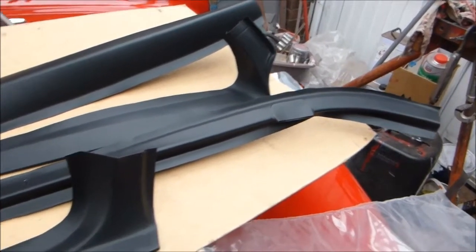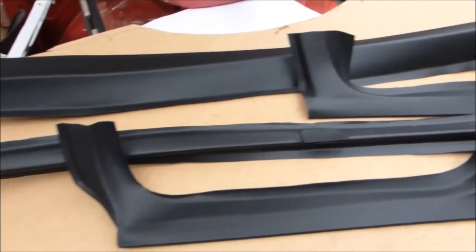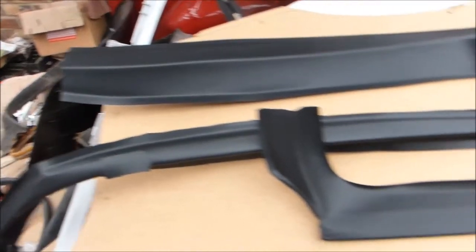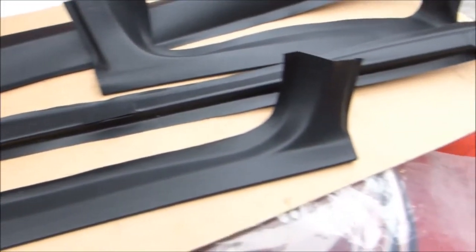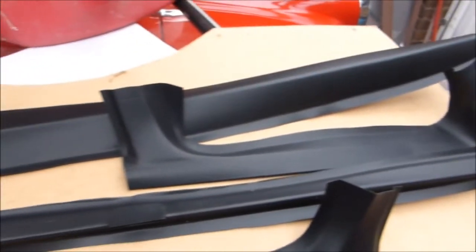If you've had trouble fitting the vinyl to the windscreen of a TR4, as I did, this is the alternative. This is a moulded set, which is a little bit more expensive, but you'll see that the fitting is that much easier. I've released the windscreen from, left the rubber behind, as you know that this part hooks over, this part here hooks over, and tucks into there. I'll show you that in a second.